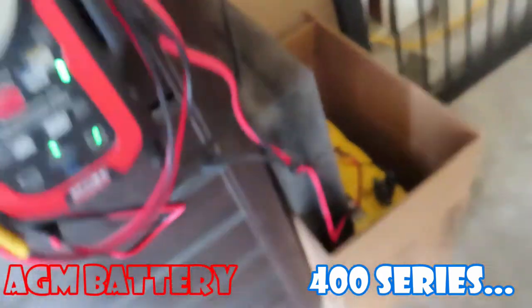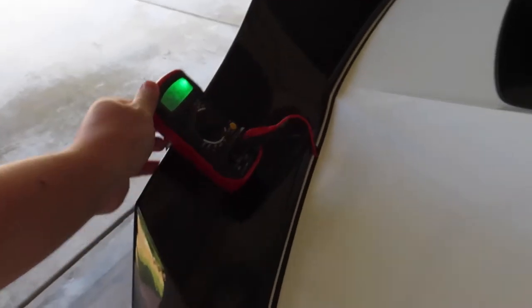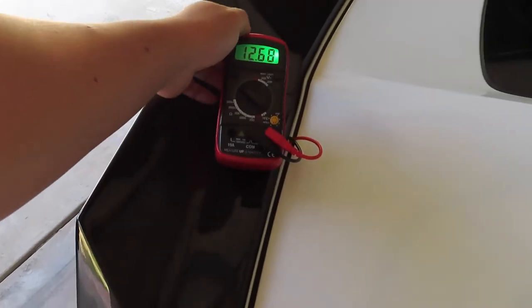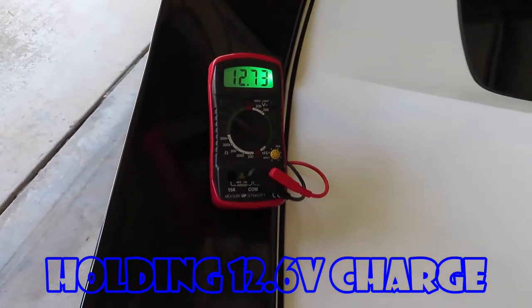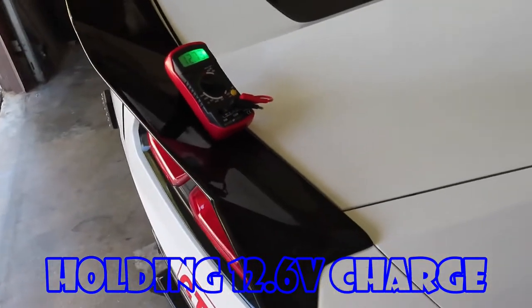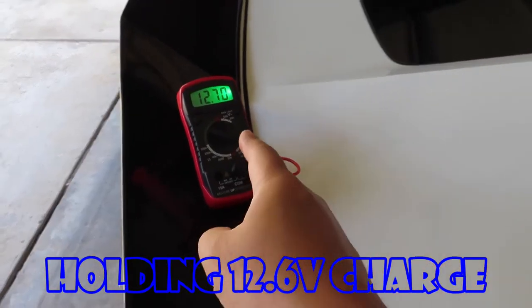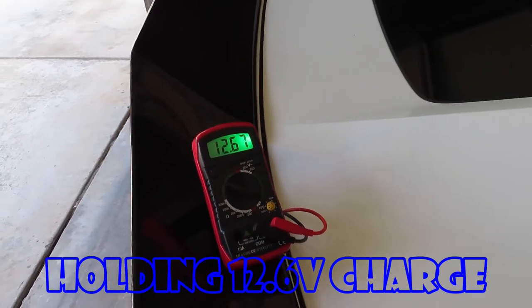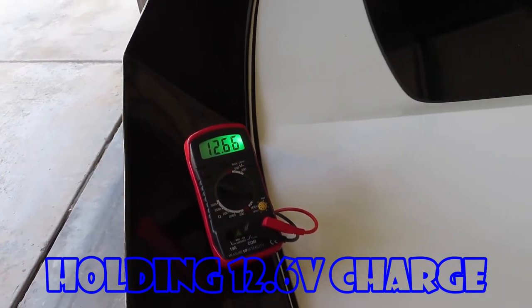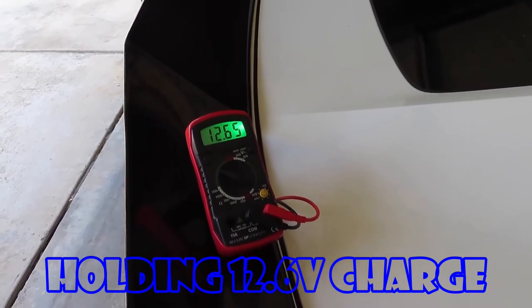Interesting. So that's that battery. The car is shut down; we are at 12.7 volts, keeps going up. Brand new battery, running on its own, not on a tender. 6 hours later we'll see where the voltage is — it's to determine if the battery can hold when I'm outside and parked.